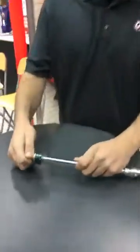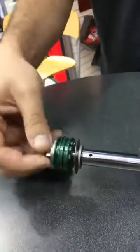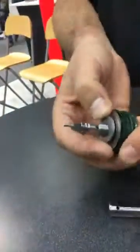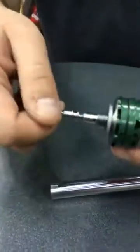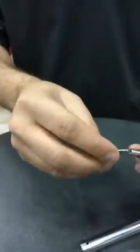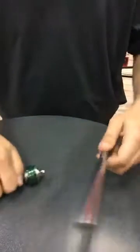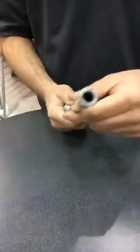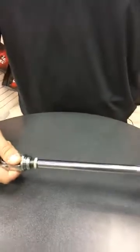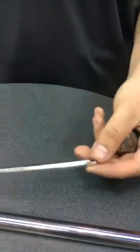On the other end here, the piston is held on a little bit differently than a typical QA1 shock — it's more of a bolt design which makes room for our adjustable mechanism. Inside here we have a bleed needle, there's an o-ring that goes into that groove there. The bleed needle screws into the seat — look at the profile of the needle there, patent pending design. It screws in, and inside the shock here it's a gun drilled piston rod — you can see it's hollow on the inside. Unscrewing the bearing mount, inside here is a push rod. It's zinc plated steel rather than aluminum, so as a shock warms up to temperature it won't close off your bleed or affect your bleed in any way.